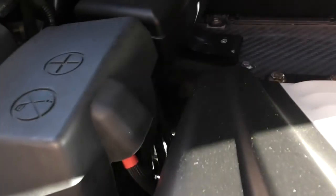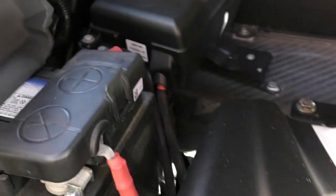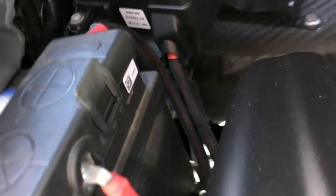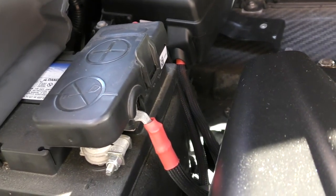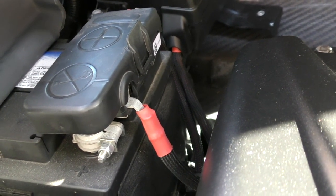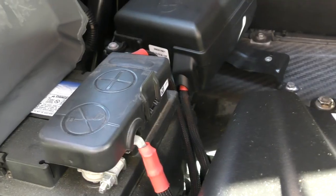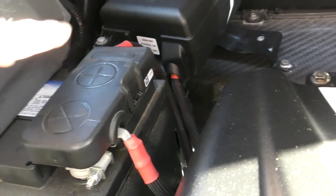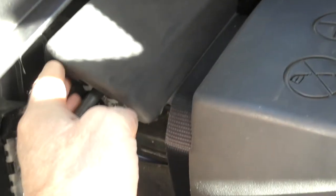because on the Alfa Romeo, when you lift what you appear to see as the battery here, I don't know whether you can see it, but here on the Alfa, you can see two terminals, one and two. And initially, some people would look at this and think, well, this is basically negative and positive. And that's exactly what I thought it was initially, that one was negative and one was positive. This actually isn't a negative and positive terminal. It's purely only the positive terminal. The negative terminal on this particular car is on the other side.